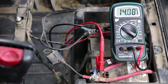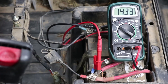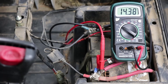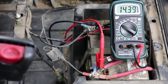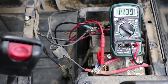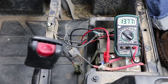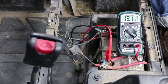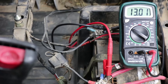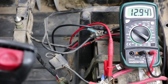There's our idle voltage, which is good — we're over 14 volts at idle. We're hitting 14.4, almost 14.5 volts, which says we have a strong charging system and our regulator is working correctly. You definitely want to check this every time you do any work on the system, just to make sure everything's working well, and that'll ensure that you have a reliable charging system.